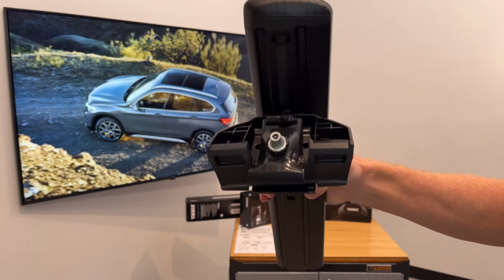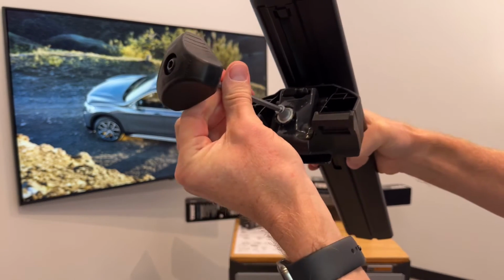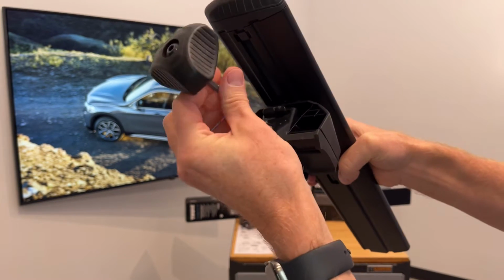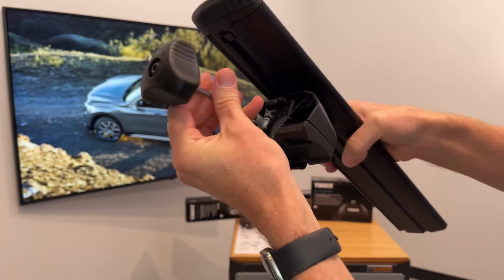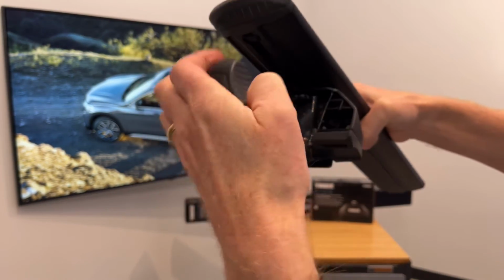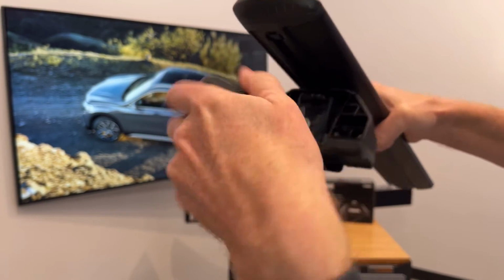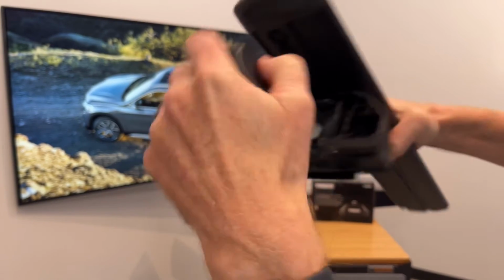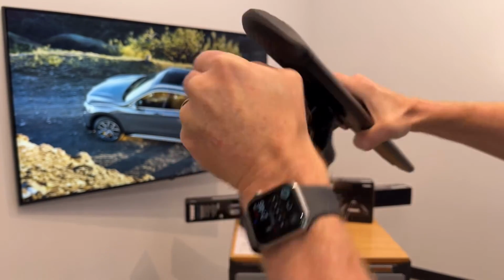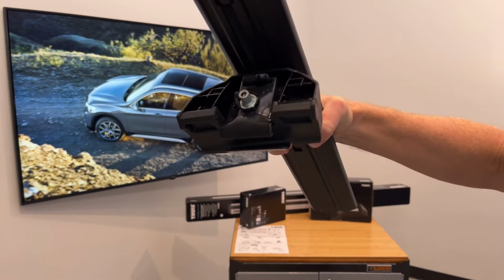Now, next step would be to tighten the side rail brackets to the side rails using the tool here that's included with the foot pack. Now that tool will tighten that barrel fastener and tighten the brackets and tighten the foot to the load bar all simultaneously. And once it's reached its maximum tightness, the handle on the end of the tool will click, and that indicates you're done with the tightening.